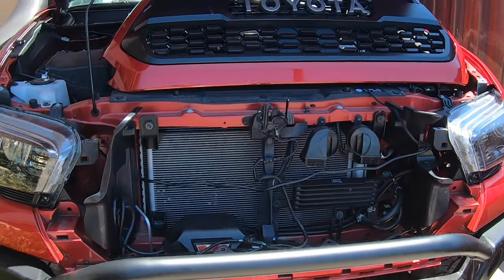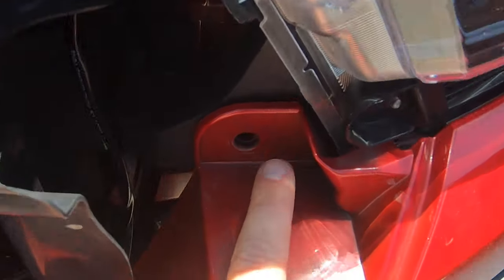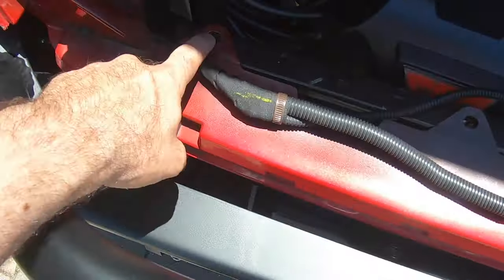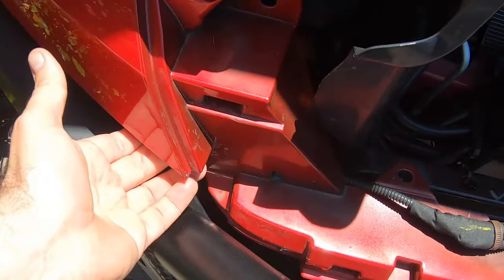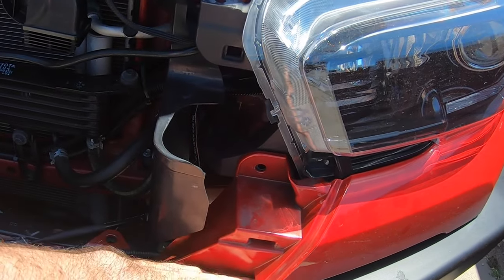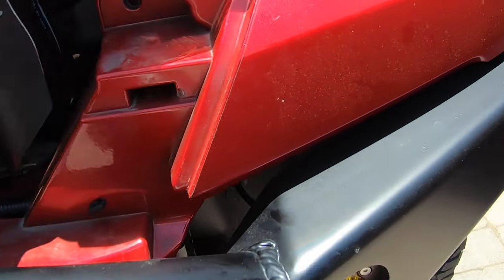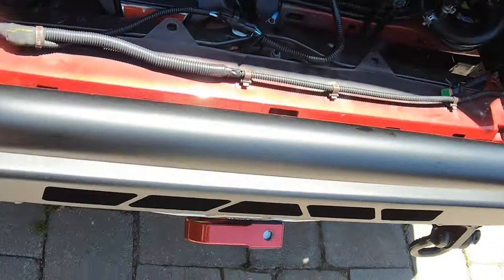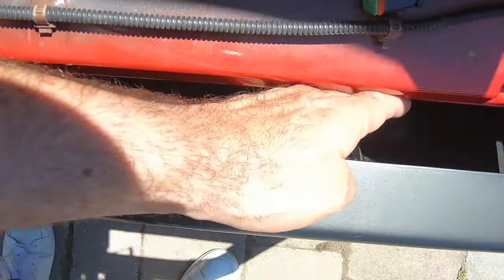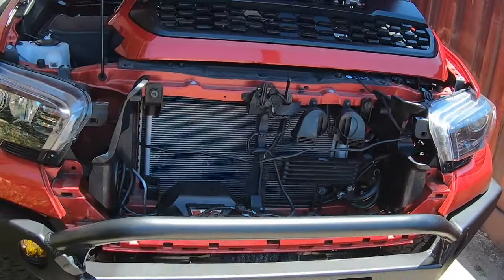All right, so there you have it — this actually came out pretty easy. The trick is to make sure you remove the clips here and here on both sides. Because if you do that, then this bottom fairing moves easily and freely, which allows you to get that front grill over this little triangle section right here. So that's a little tip. Now, as you can see, we've got easier access to get in there. Now we've just got to mount the bar and do a little wiring — so that's next.